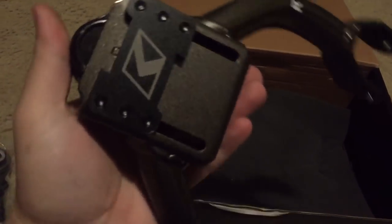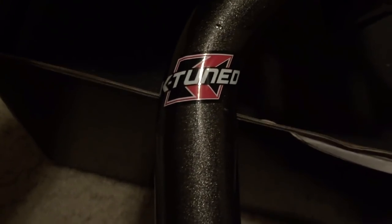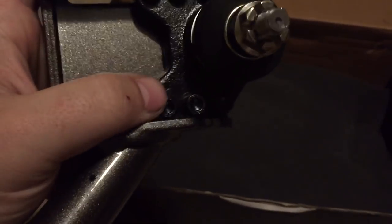Come with two cotter pins. I'm going to pull this one out of the bag. Here they are - up to positive five camber, that's what I'm looking for. There's a ball joint and that's how you adjust them - as you loosen up these six allen keys and move it.